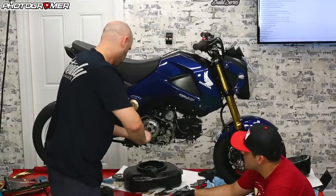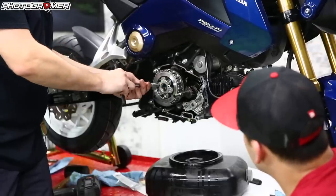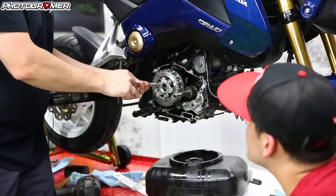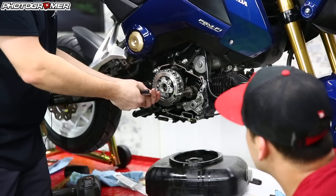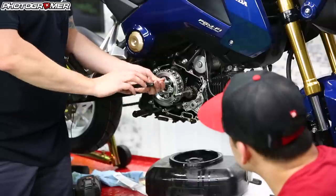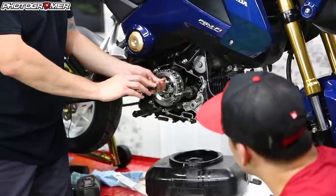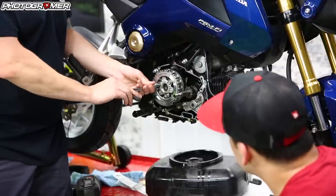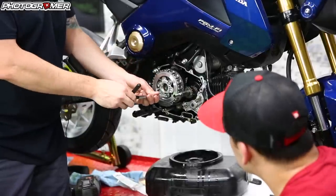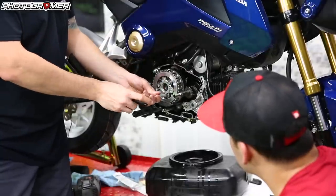What I'm going to do now is just do quarter turns on each of these until it gets tightened down — half turns, going around the clock real slow. It's tedious, but this is the proper way not to snap anything. Just keep tightening until it gets hand tight, and then you're supposed to torque them down to nine foot pounds. What I've found is sometimes when you torque these little bolts, especially with this soft aluminum, it's very easy to snap these stems — and I've had these just snap for no reason while I'm doing exactly what I'm doing now.